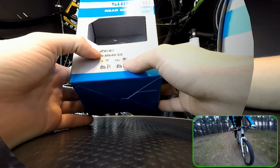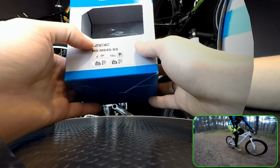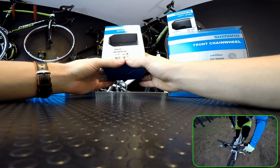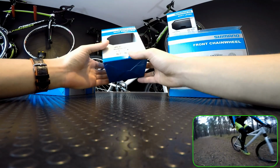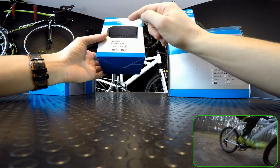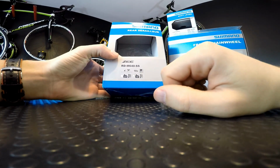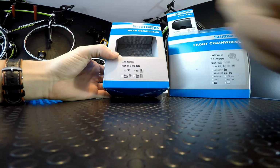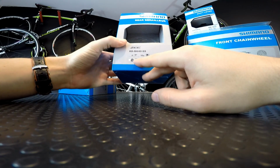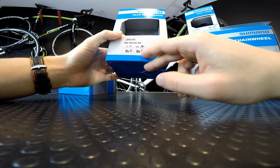And finally we've got a great, in my opinion, derailleur, Shimano Zee. This is the model that is made for more gravity cycling, like Saint, but this one works just great. In our bike we've got, of course, the Shimano Shadow Plus rear derailleur. It's 10-speed compatible, and this is a free ride version, not the downhill that would take up to 28 teeth, but the free ride taking up to 36.